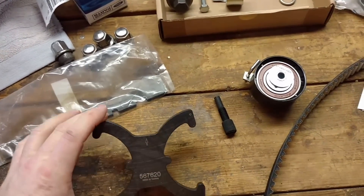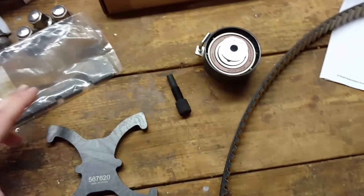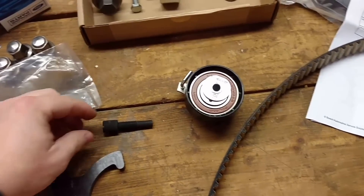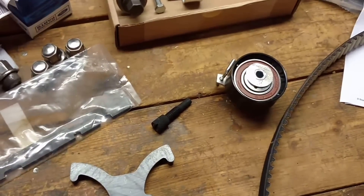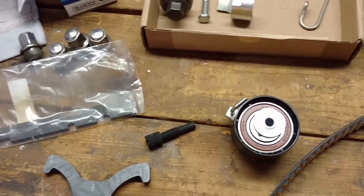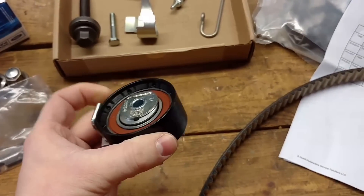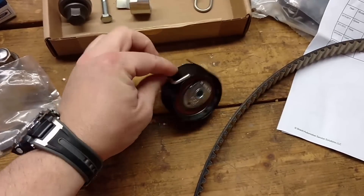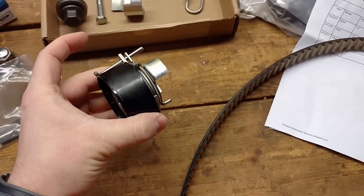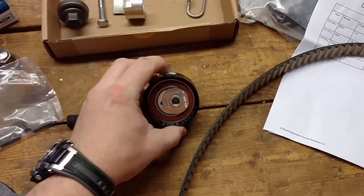The only thing you really need is this camshaft gear lock tool, and then this is the top dead center pin that you insert in the back of the engine — it's right behind the cam or the drive shaft, so it's going to be a little tight to get to. Here's the timing belt tensioner pulley. It's an automatic tensioner, so all you have to do is install this. These tangs just go into the body of the engine and then you pull this pin once you get the belt on there to release the tension.